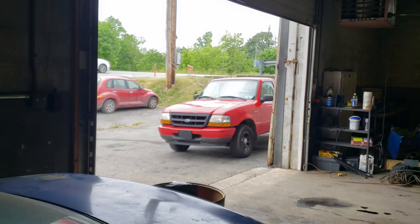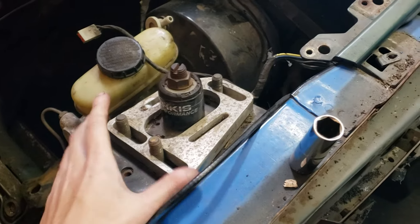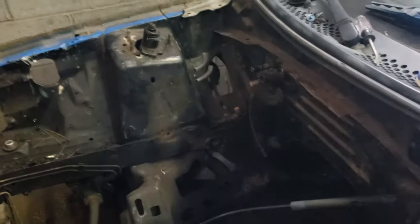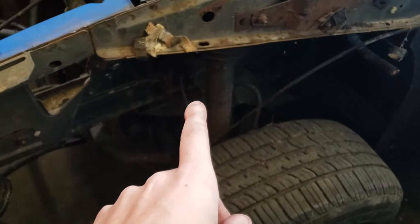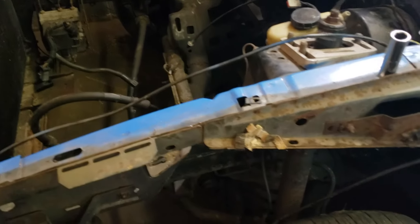Cody got here and left on the rollback. I got the two Allen bolts out and three regular bolts — this will slide right off. Then I gotta find the wrench and unscrew the top hat, take the cover off on both sides. The sway bar is disconnected over there, I still gotta disconnect this side. I got one bolt out on the other side. I got six bolts left and this entire front end drops out from underneath the car, so I'll come back once we get more done on it.